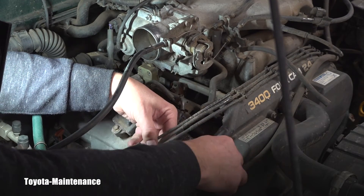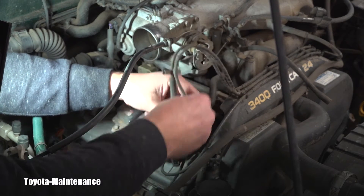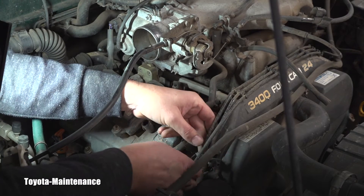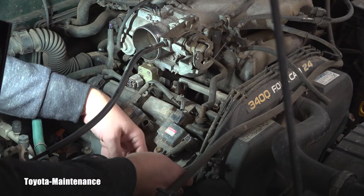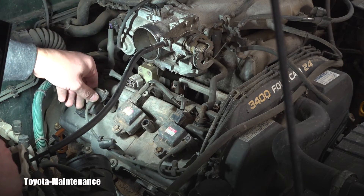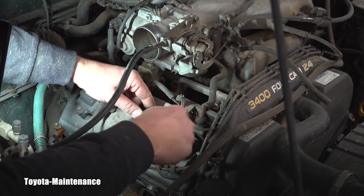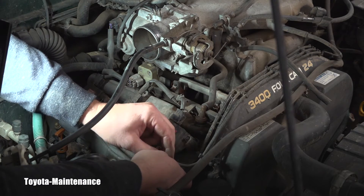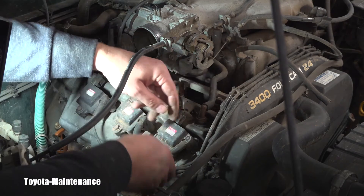So we are supposed to route it correctly and carefully so the cables will not touch each other. Look — I will put this one underneath this holder, and this one will go above, perfectly separated from each other. The long one goes here and clicks nicely. I will click this one — these are cylinders one, three, and five. You hear that? Now here again I will use this plastic separator to keep them from touching.